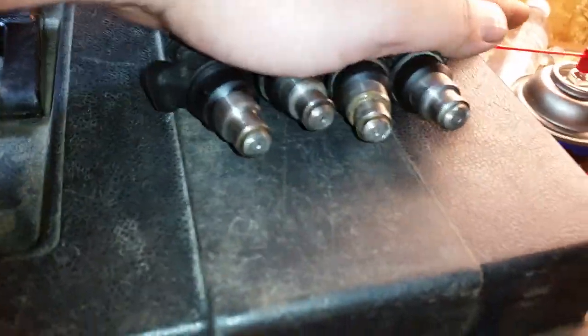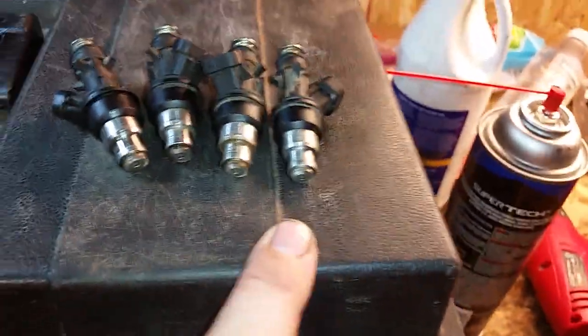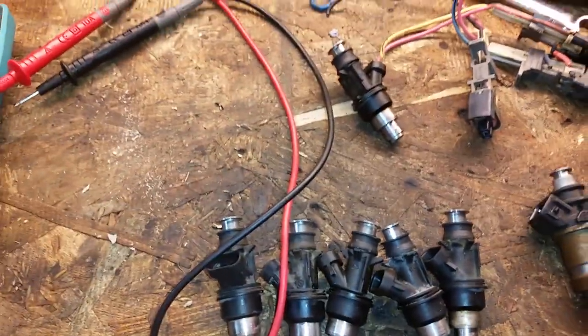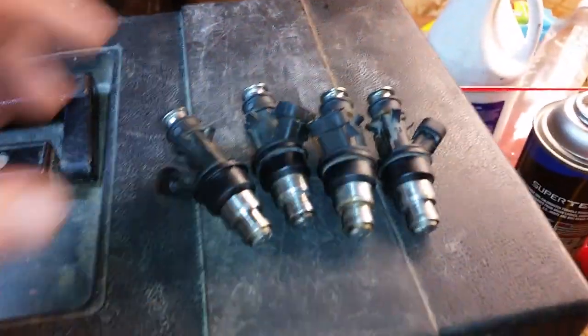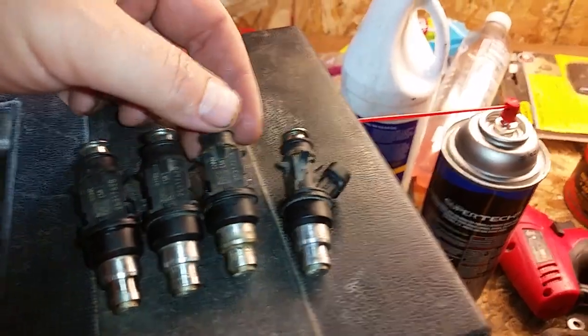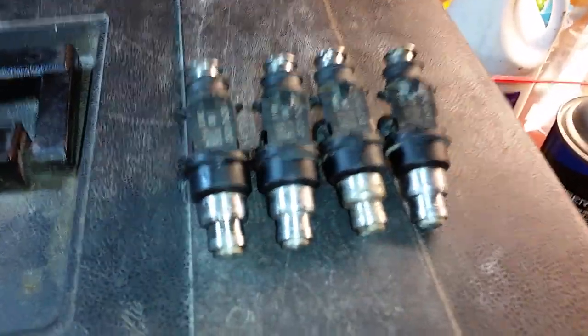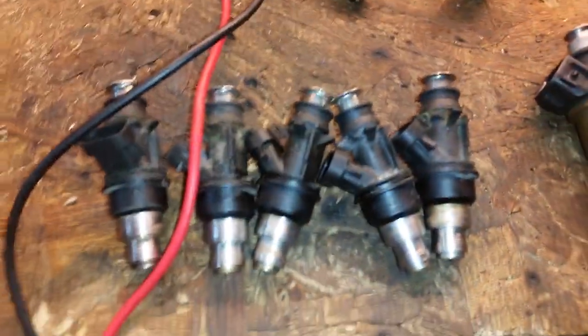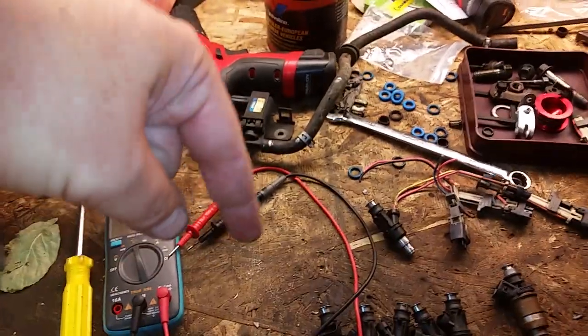Hope that helps out. These are the decapped GM short style non-flex fuel injectors out of early 2000s V8 Chevy vehicles that you can get for about 20 bucks. Or if you want, you can get them from Hunter Tune already flowed and already decapped — and even at that price they're far superior to anything else you're going to get for that money. These are OEM injectors, not cheap eBay knockoffs. The only thing is you're getting used injectors, but injectors don't go out too often and they're pretty robust, especially these GM ones. Hope that helps — put any questions down in the comments and we'll check you later.